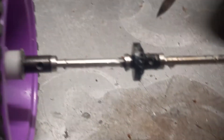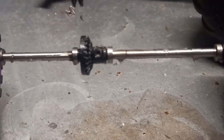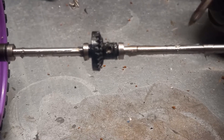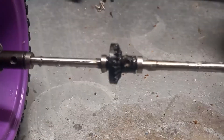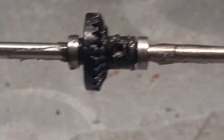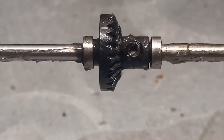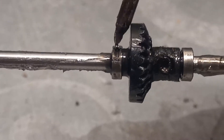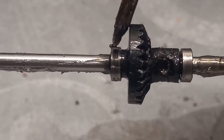You can still see there is lubricant hanging right there and all over the shaft. You can still see it on the ring gear. Now that we're close up, let me spin this bearing around — look at that, we've got a split bearing.